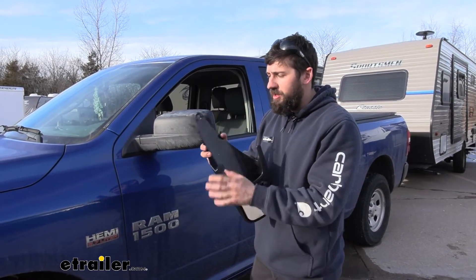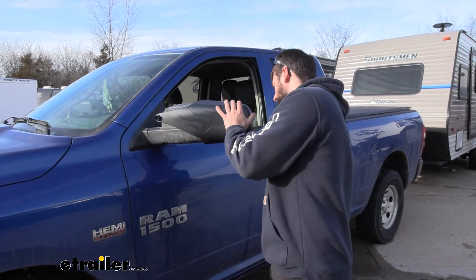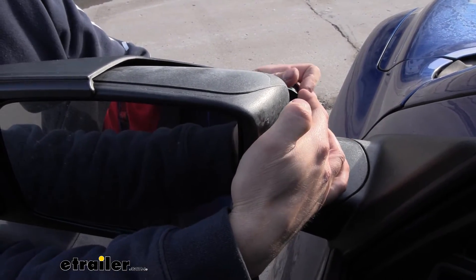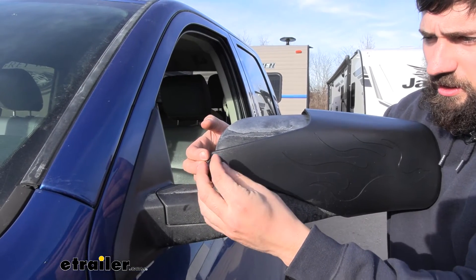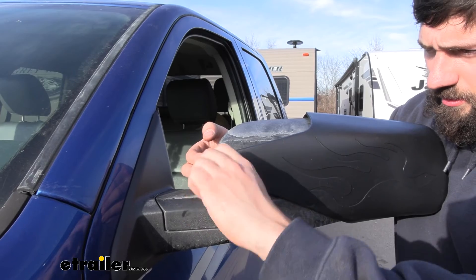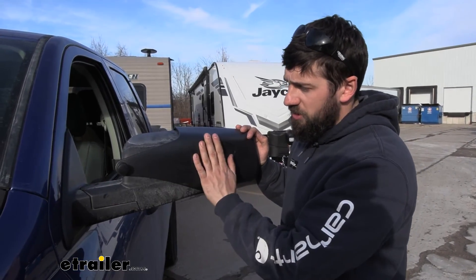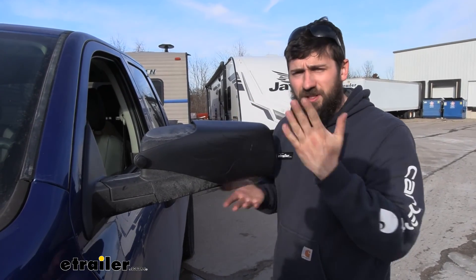Once we've done that, we're going to grab the towing mirror labeled LH — that's for the left hand side, your driver's side — and we're just going to simply line it up and slip it into place. Once we get it into position, we're going to take our hook here and feed it from the other side out through that hole there. Make sure it's grabbing onto the plastic housing, then take your thumb screw and depress it around the mirror and simply thread it on until it catches. It should start to align within the hole there. We're not going to go too snug because we could risk breaking it, but just snug it up. Once tightened down a couple turns, grab the mirror and check for movement — if you have too much movement, tighten it a few more turns. Ours is pretty snug, so that's good.